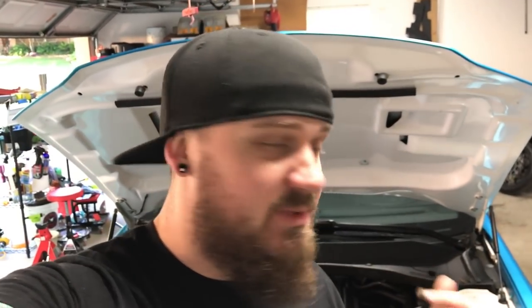All right, guys. Hope you enjoyed this video. Hope you found it informative. Not only did we get the Mishimoto aluminum overflow reservoir in, we got the 180 thermostat in, which is a huge plus for this car, getting it to run at lower temperatures. We got all of the new coolant in. I've got extra coolant just in case. We checked the level, everything looks good. I will check it periodically throughout the week and make sure that everything is good and we don't run low. Last thing we want is the car to overheat.